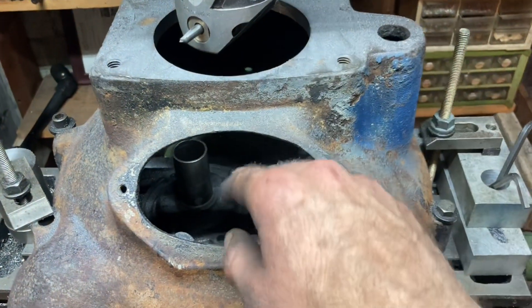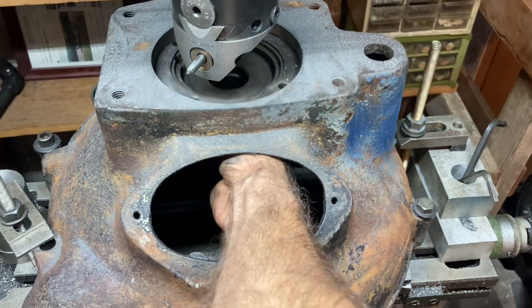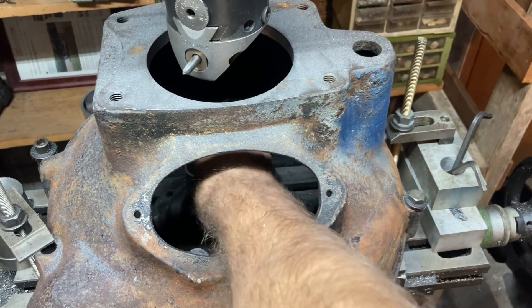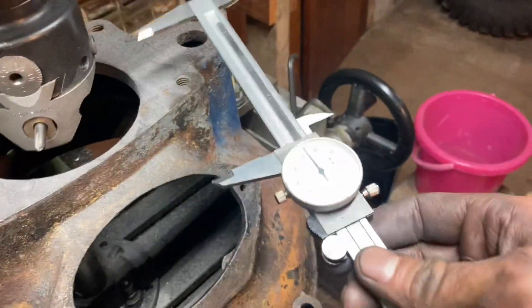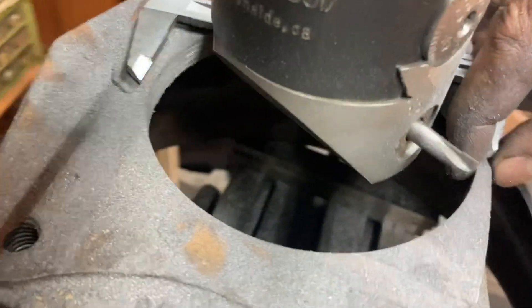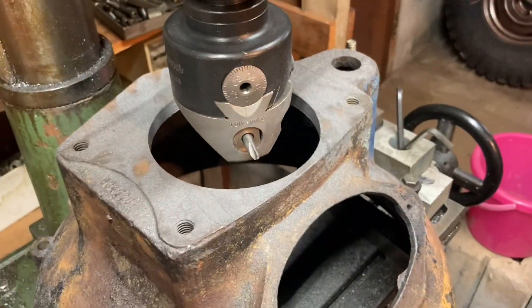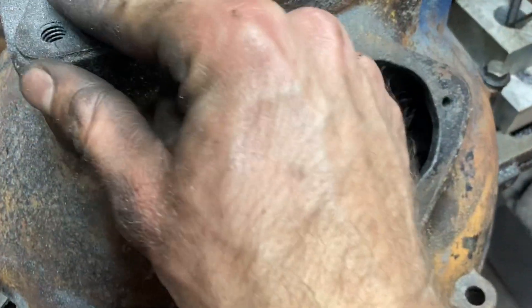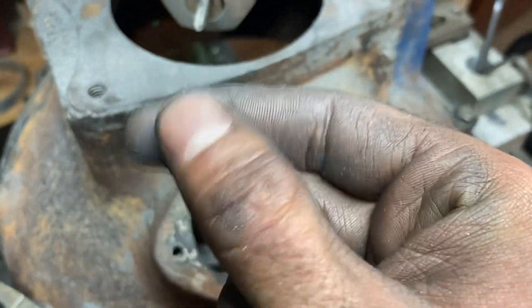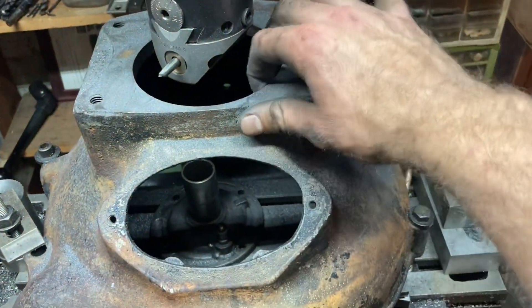Tip: if you're using a bigger table than me, put that inside there first and then indicate it. I have enough room to sneak it up through there. If you're going to use it as a test gauge, it should be a pretty snug fit. Obviously measure as you go — I locked this on that dimension just as a quick reference. We still have about a sixteenth on both sides left to cut. Cast iron cuts easy but boy is it a mess — it comes off like dust, throws it at you, but it stays cool and doesn't really need lube.